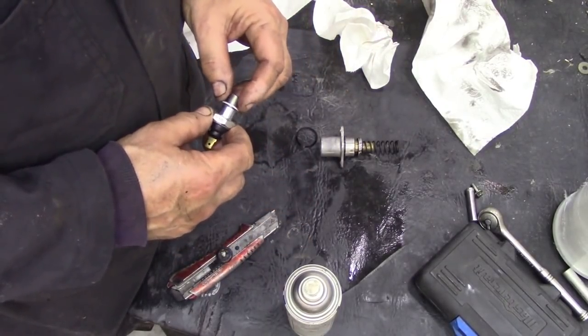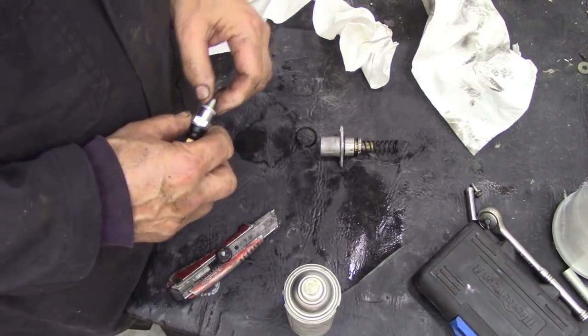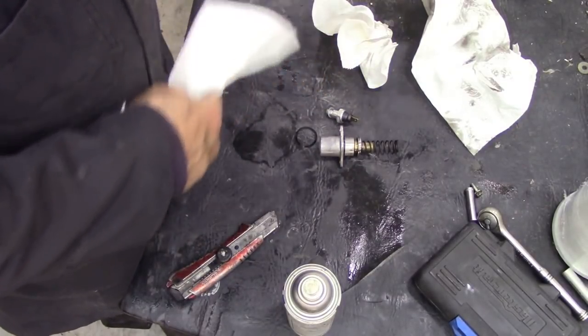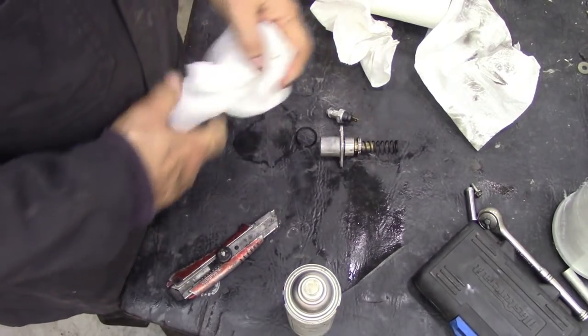It is a low pressure switch. I think the oil pressure to put the light out is only 4 psi on these. Mind you, by the time it gets to 4 psi, damage is done, isn't it? So let me get these all bolted on and I'll show you what it looks like. Mind you, there's not much really to see, is there?